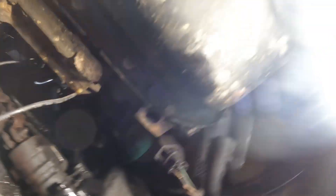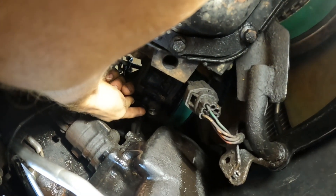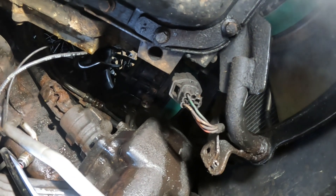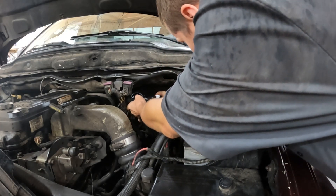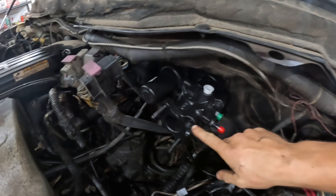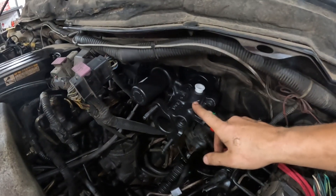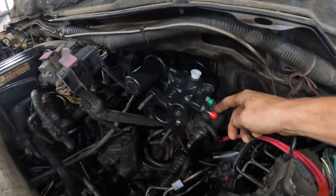I can stand on my bumper, so I just squatted down and got this with a 20mm and 18mm. From there you can go down below. Once you get those, you have access to this one on the bottom of the pump — that's the output from the pump. Try to observe the correct orientation of this unit. Those two lines go over to the right. One line goes straight up, and then two lines go slightly downwards on the right.